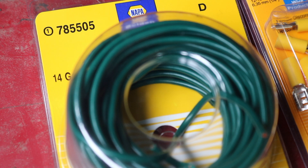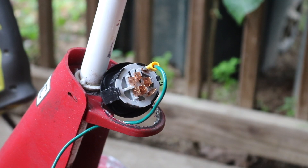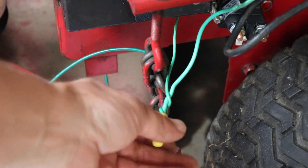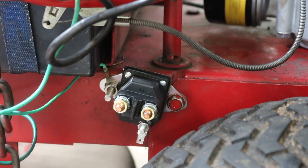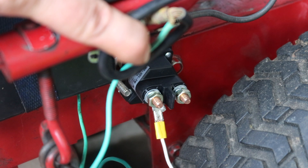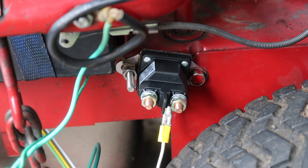I run the green wire to the terminal labeled G, and the other end goes to my common ground right here. I'm doing a common ground to make everything clean. The bottom right side of the solenoid — I had to file it a little so my connector fits. This goes to your ignition key where it's labeled S for solenoid. I went with a white wire — the white wire goes from S on the ignition switch back to that little tab on the bottom of the solenoid. This next one is easy: from the right terminal on the solenoid straight to the starter terminal.